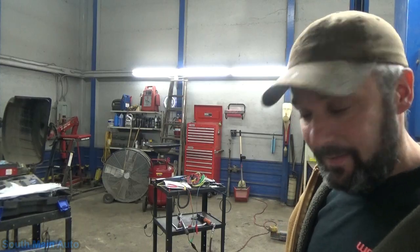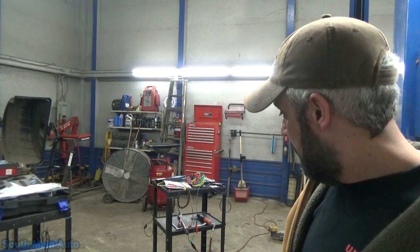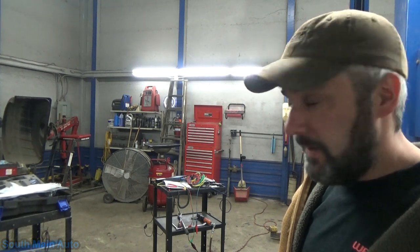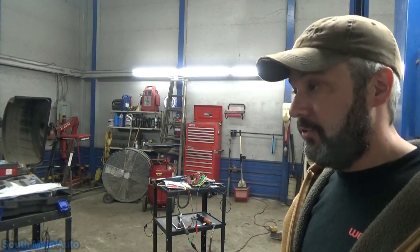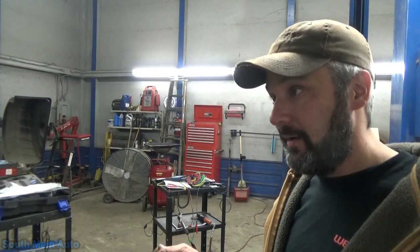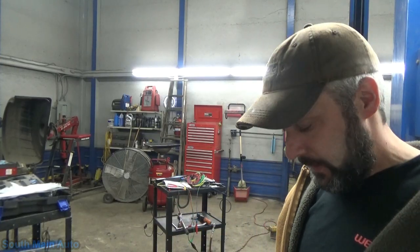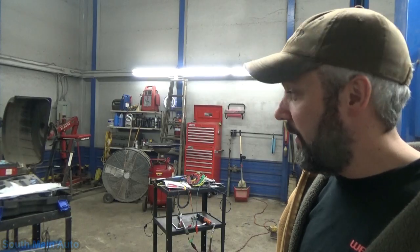I would rather pay someone to tell me 100% what the problem is, guarantee their work, and move on. It just bothers me why that light will not come on. Open-circuited, short-circuited to ground and to high voltage on both the COM and the MON wires, plus open circuit on all three wires, it still did not generate a code. And that bothers me, and I'm going to lose sleep over that. And I don't have the answer for it.